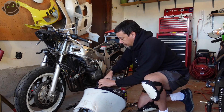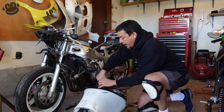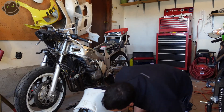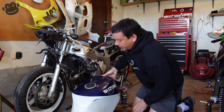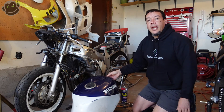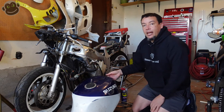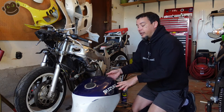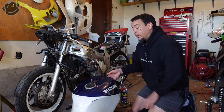It will work this time, I swear. We're going to end up putting two and a half gallons of lukewarm water in the tank, along with Tank Prep A. It's going to take many hours. We're going to have to move the tank into different positions because it's a four and a half gallon tank and two and a half gallons obviously won't cover all the areas.